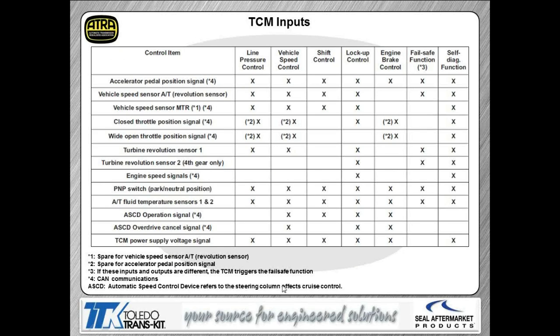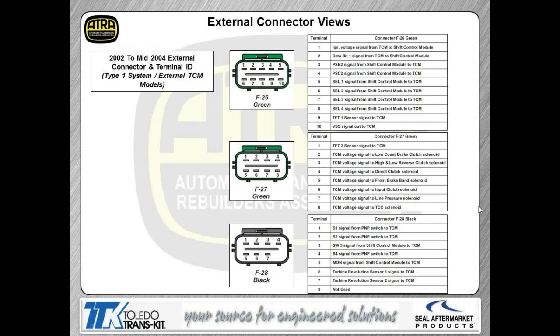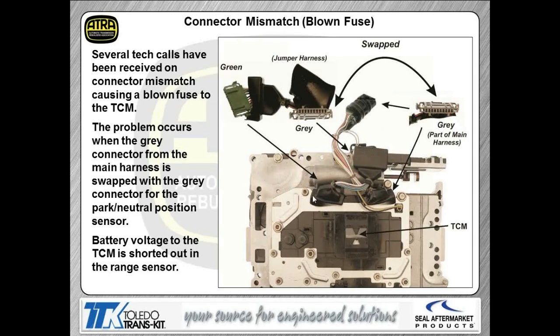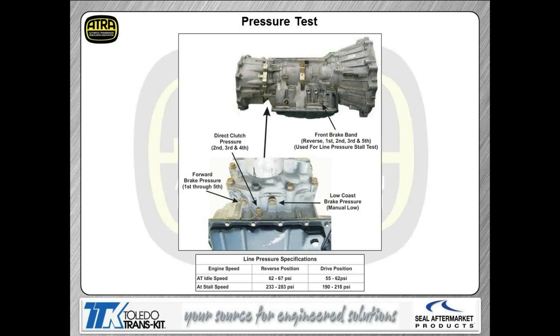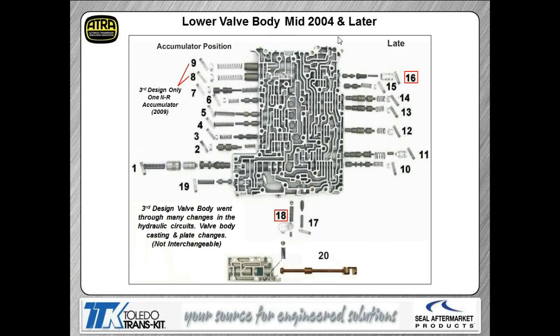Just recently found out that Matic J fluid is no longer available. It's been replaced by Nissan with Matic S. A friend of mine from CVC Converters gave me a call the other day, said he had 2 of his customers with Pathfinders that had a shudder and lockup. Now they use 2 different aftermarket clutches in the converters, so we're not sure exactly which one, or if both, could be causing this issue. Now, the shop was only using Matic J. They don't use anything else, but now that it's no longer available, they purchased the Matic S fluid, and both converters still shuddered.